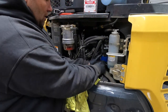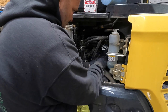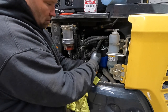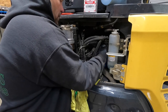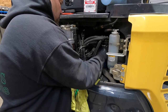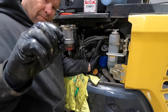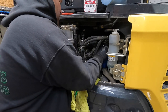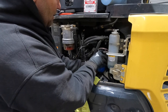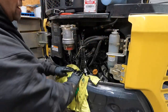What I do is just like that — you take the filter off and you can catch a good majority of the fuel that comes out. You let the filter drop down into the bottom of the quart jug you cut, and it'll keep a lot of the excess fuel from spilling. You're not gaining much height except for just a little bit on the bottom of that filter. It caught the fuel out of that fuel filter.